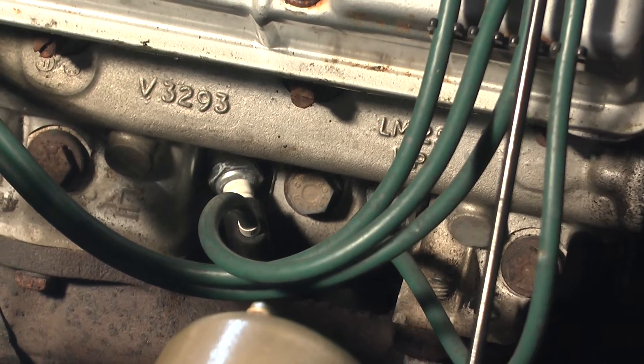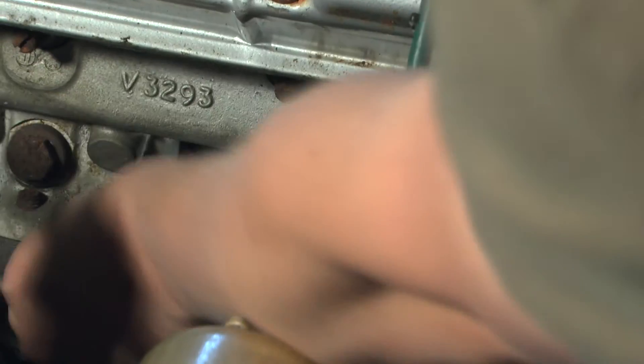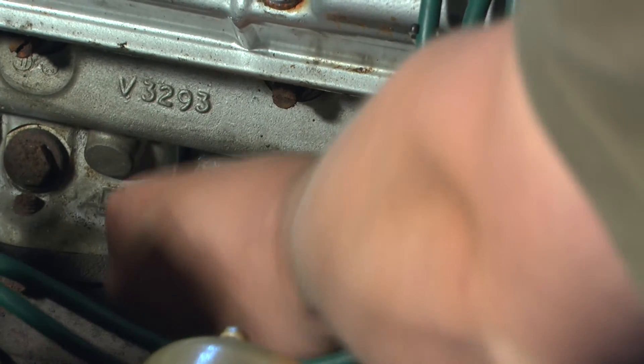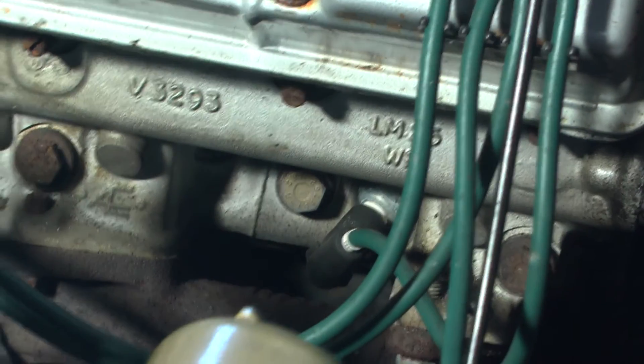Where would you have to go first, James? It's inside the spark plug hole — yeah, that's the technical term. So first of all we're going to start by removing the spark plug so that we can put the endoscope in. We remove the plug lead then loosen the plug a bit before removing it by hand. For those of you who are curious, this engine is actually a 3 litre V8 from a Triumph Stag. It's all original and was last rebuilt some 25 odd years ago, so it'll be interesting to see what it's like inside after all that time.